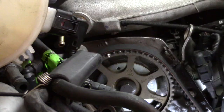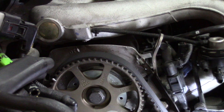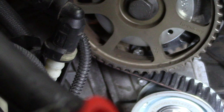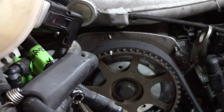Now I want to double check that my timing marks didn't move — crankshaft mark is still there, camshaft mark is still there. I'm going to turn the camshaft 360 degrees, which would of course be 720 on the crank. The critical thing here is to keep rolling to the point of top dead center — don't stop, because when you stop it affects the tension reading. Keep rolling smoothly to your stop point back to top dead center to ensure the tension is accurately set. The tensioner is dead-centered in the notch, so we know the tension is set right.